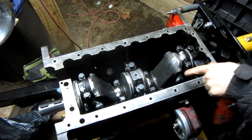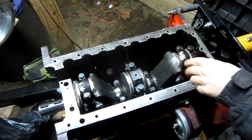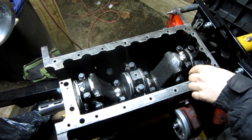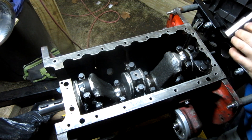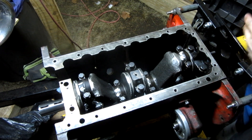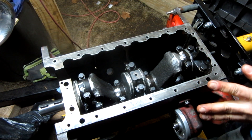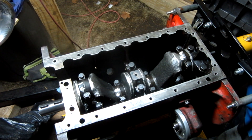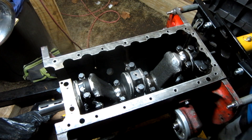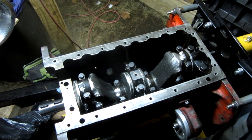While I'm waiting for not too much time left for the gasket sealant to cure, I'm going to go ahead and tighten and torque down the piston cap bolts. The torque on the piston cap bolts, according to the original manual, is 40 to 45 foot-pounds, and I've got mine set to about 43.